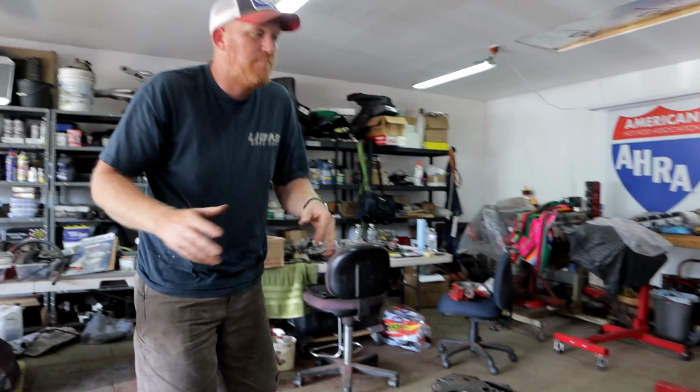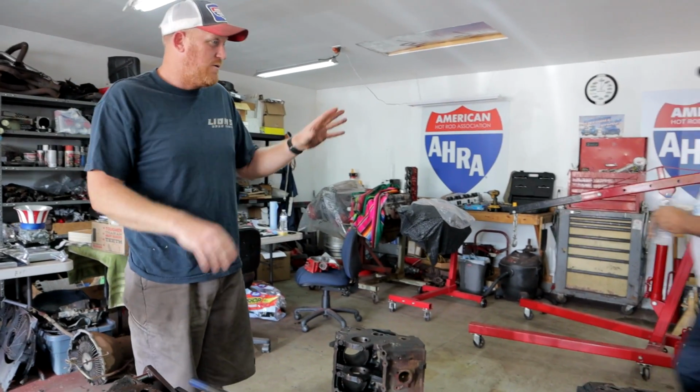There's a lot of things that people don't understand about the Stage 1 Buicks. When the program came out, it originally was just a camshaft, a different carburetor, and a different distributor. The compression was actually the same, all 10 1/4. But when they went to the Stage 1 program in '70, it became the Stage 1 head. Plus you got the cam, distributor, carburetor, and fuel pump. I want to do heads in the next installment. That's fine. Let's just focus on the blocks.